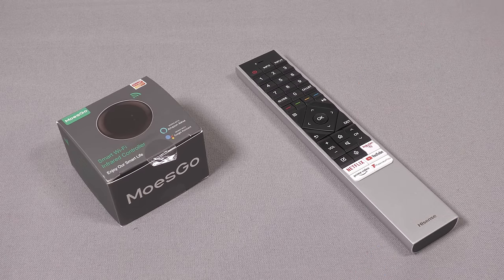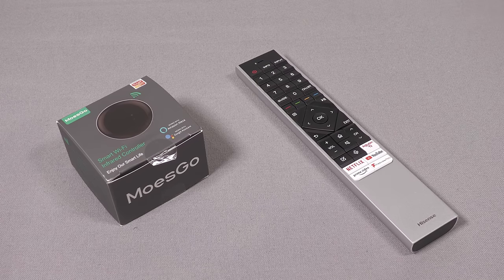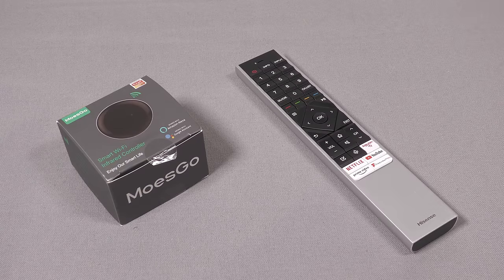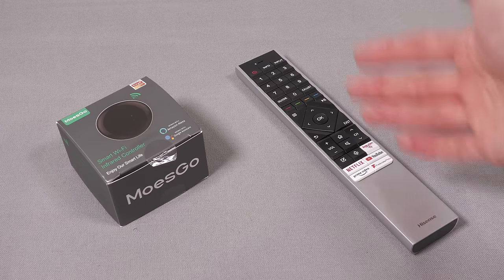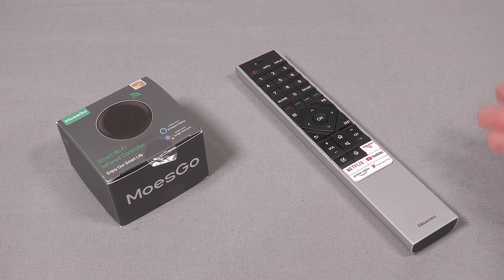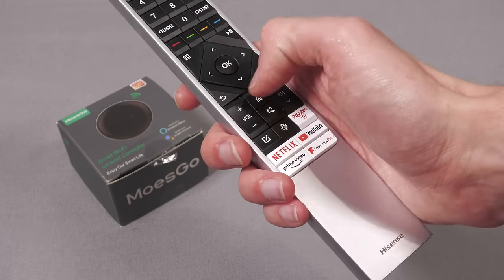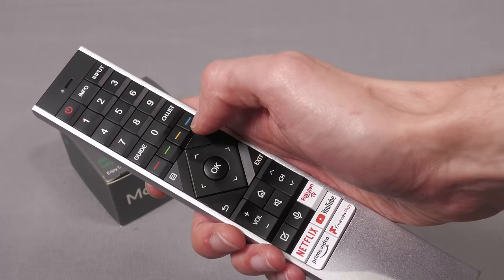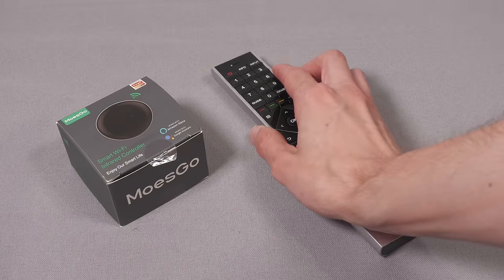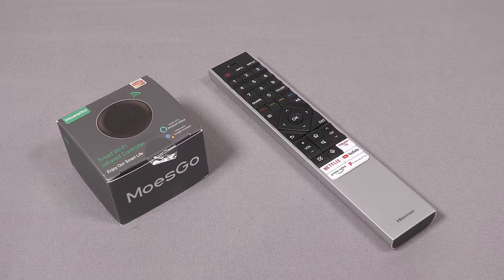With my previous Sony TV I used the remote to control things like my satellite box and AV receiver and it was really good - I could change channel on the satellite receiver, switch inputs on the AV receiver, all that sort of stuff and it all worked perfectly. Whereas with this new Hisense TV, over HDMI CEC it doesn't pass half the buttons through. The only buttons it passes are the direction arrows and the play button, but none of the numbers or the guide button are passed over HDMI CEC. That's really annoying because I grew used to just using the TV's remote and having one remote for everything.